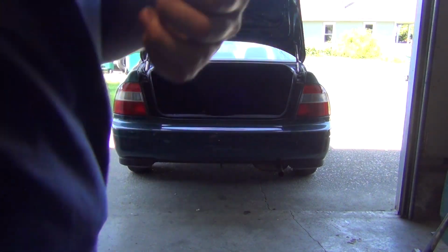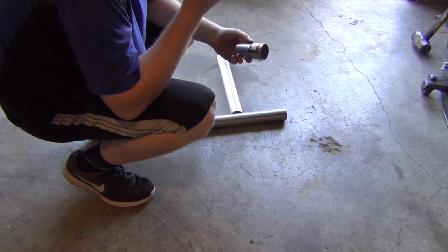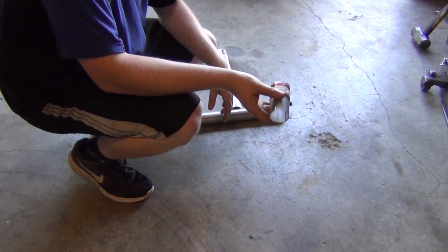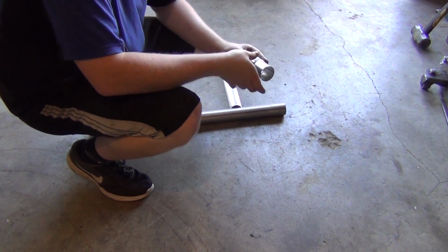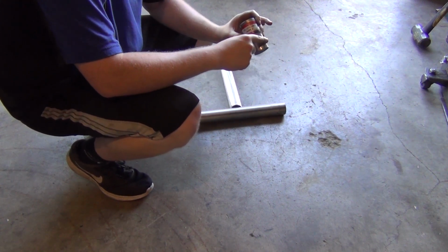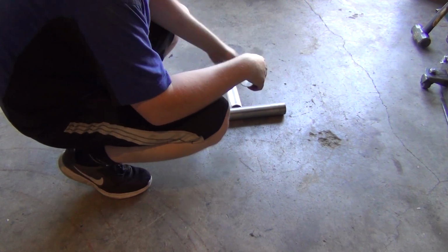We're gonna make this real fartish. Bought some bits. So I've got inch and three quarter exhaust on this side, this little adapter. This end's a little loose, but it's close enough. I'm just gonna crimp the end so when it goes on, it's kind of snug. And then I'll get it straight, and then we'll tack it, and then weld it on up in there.